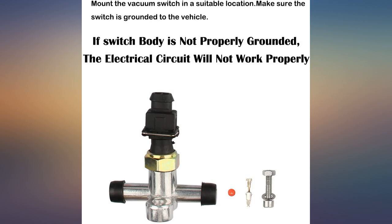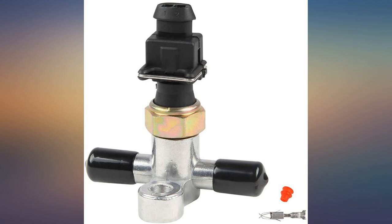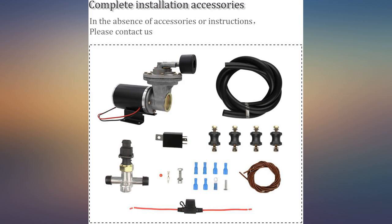On its own it did not switch off completely, but stuttered. After adding a check valve and reservoir in the vacuum line, it performed 100% perfectly. I used this product on a 59 Corvette fitted with an aftermarket dual master cylinder with an 8-inch booster.